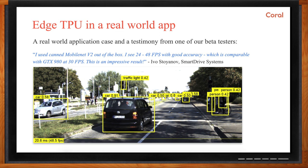That's right. So the power that you put into this AI system, some of it goes to the CPU, some of it goes to the GPU, some of it goes to the TPU. And now we're into the space of clever system design, clever algorithm design to push your computation onto the processor that's best suited for it to minimize the power required to do that computation. So all these three things want to go together, right? Your GPU for your rendering and your graphics pipeline, your CPU for your general purpose computation and pre and post-processing of your data, and then your TPU to crunch your inference.